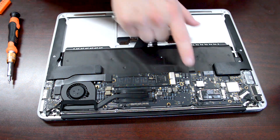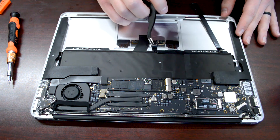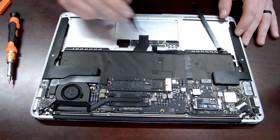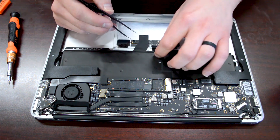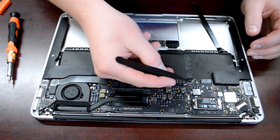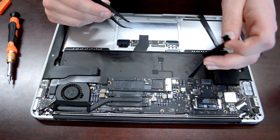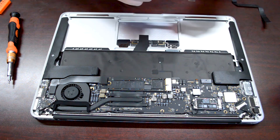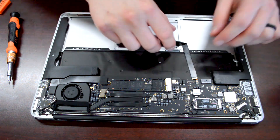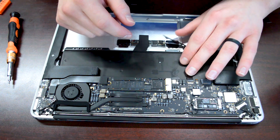Remove the battery and battery harness together and set that aside. Now locate your flex cable. You'll want to push up on the backside of where the cable connects — there's a little flap before you pull it out. Using tweezers or your finger, flip up the backside tab, then pull out the cable. There's a little adhesive on it, so just pull it right off.